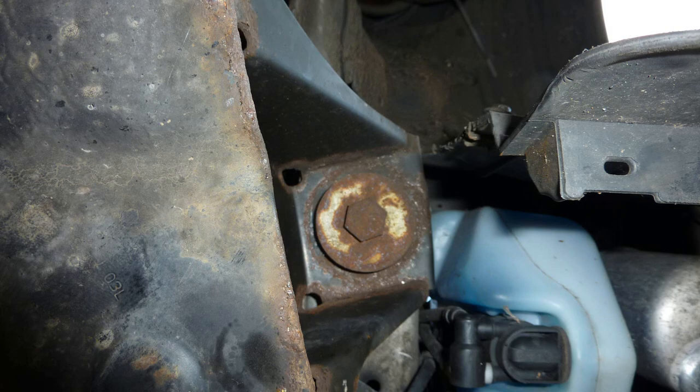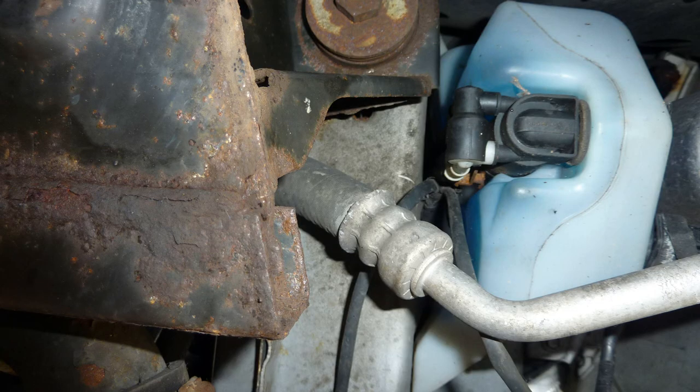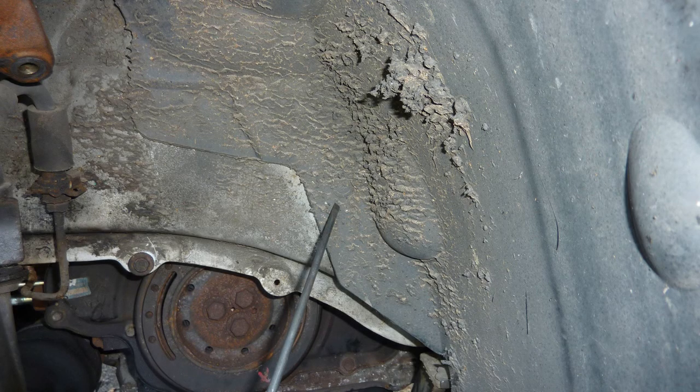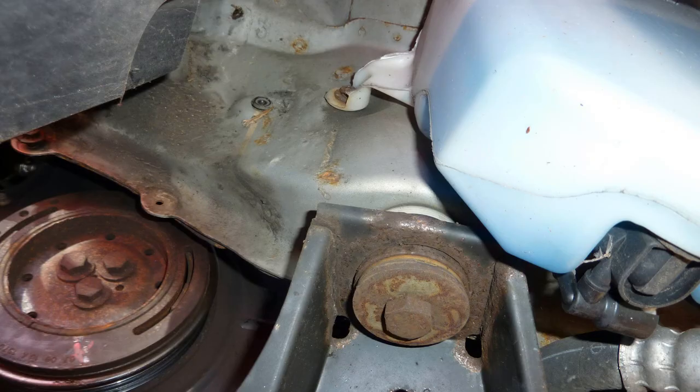This is one of the mounting bolts for the subframe, the front one, I think. Here I'm doing that trick again when I'm trying to line it up, trying to figure out how it lines up. In the end, as you see later on, I put paint around it, oil paint actually, from oil painting pictures kind of paint. And I use that as a guide later on. Another area of the wheel arch shields. Pointing to a little plastic thing, it barely can be seen. Subframe bolt front, very visible now.